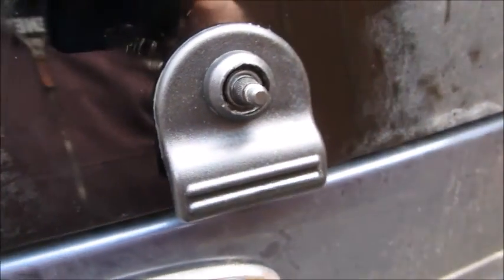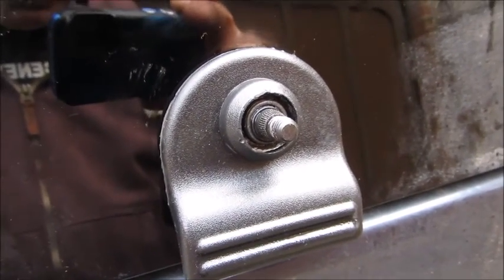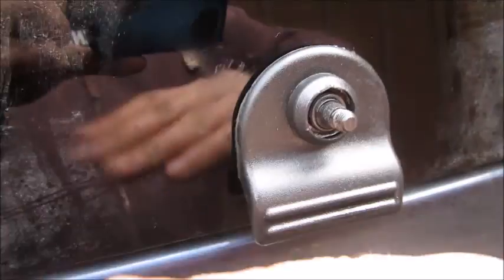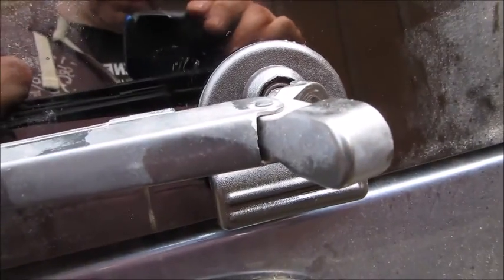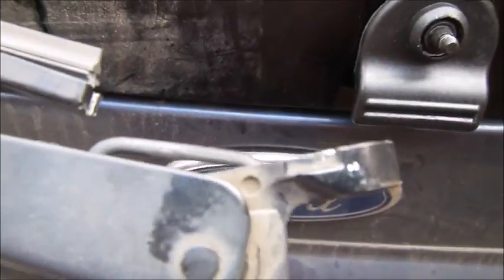Okay, so once the little rubber seal is in there, I pushed it in gently with the end of a screwdriver. Actually you need to turn this, make sure that it's in the leftmost position. You'll hear it click, so that it's ready to go, and then you're going to put the wiper blade back on so it lines up with the marks on the back of your windscreen. I'm going to need two hands to do that because it's set at an angle with the spring holding it. So back in a sec.